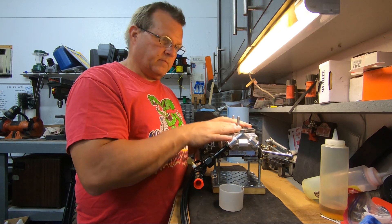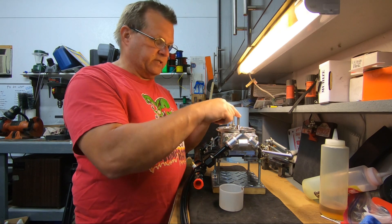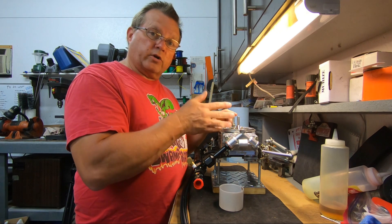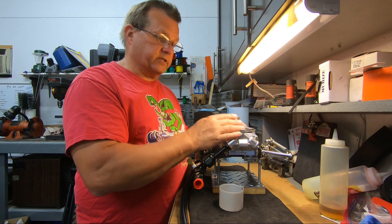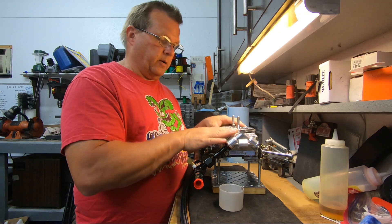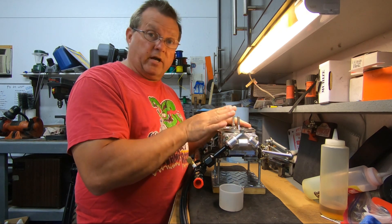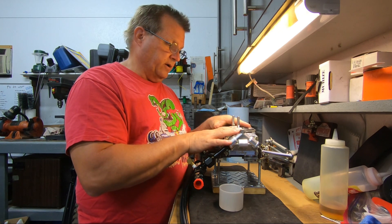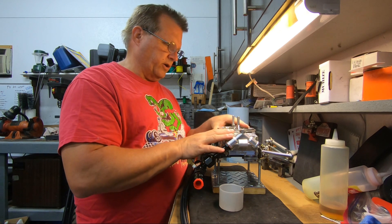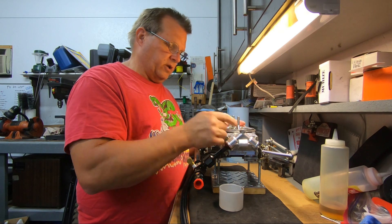The concern is these vent tubes at the top are open to the alcohol that sits in these bowls. It's kind of an open system, so moisture can still get down into that alcohol. We'll make sure all that is cleaned up before we go to the track. If I'm running week to week I probably won't do this, and I've been perfectly fine doing that. But after a few weeks I get kind of leery of it. Maintenance is the key to keeping things running good, so let's get started and get these bowls pulled off.